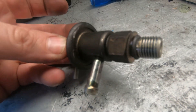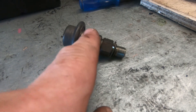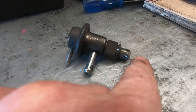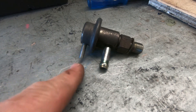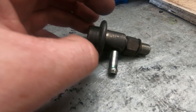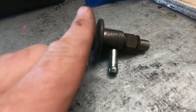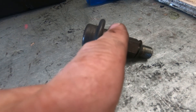So what does it do and how does it work? Petrol goes in there. Inside there is a spring and a diaphragm, and basically when the pressure exceeds a certain point the excess fuel goes out that return line. It has vacuum on it — when you apply vacuum, the sucky thing on the top, it decreases the effective spring pressure. Or if you add pressure, like in a boosted situation, it increases the effectiveness of the spring — it adds to it, changing the amount of fuel pressure.